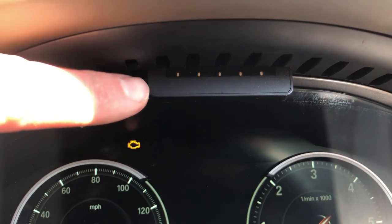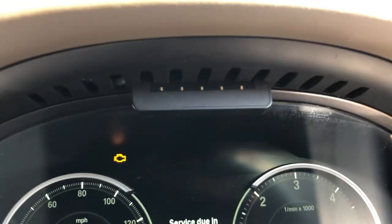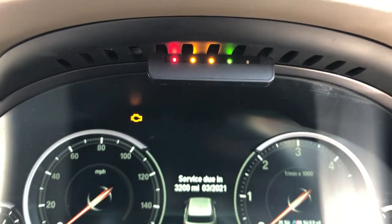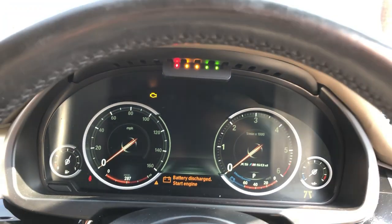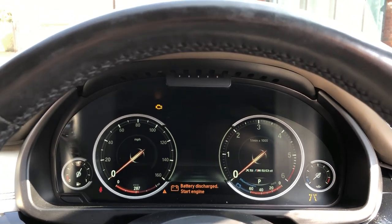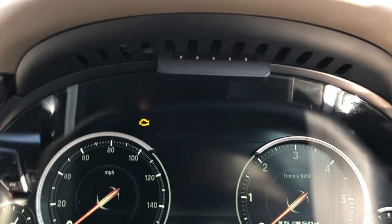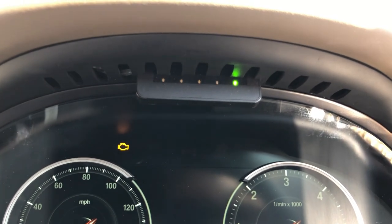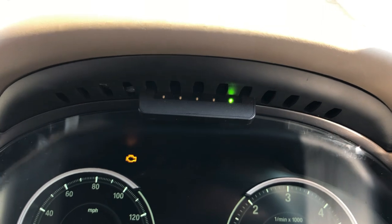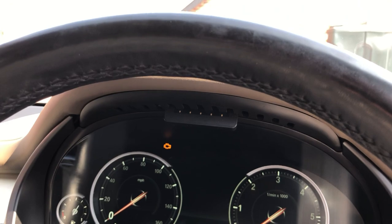The second thing in this car is a Target Blue Eye internal driver protection system. What we've done is invert the display and flush it up into the cluster. This is emergency service vehicle detection — it will warn you of approaching ambulances, fire engines, police cars, and unmarked police cars, giving little beeps. It works by measuring the strength of Tetra radio signal. That's quite cool.